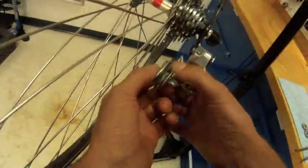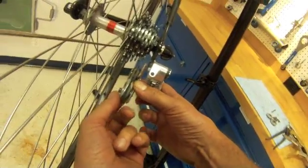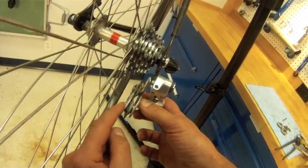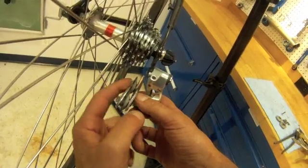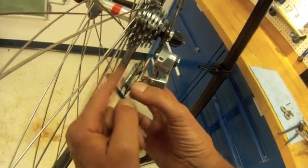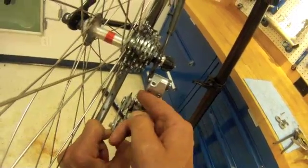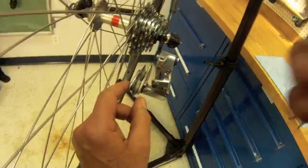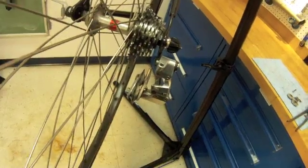So we're better. I think we're quite a bit better. The two pulleys are nice. This cage is tweaked in, deformed toward the pulley, or rather outward from the mid-plane of the bike toward the pulley. This one as well is deformed, but I think our two pulleys are looking pretty good. A little more fine-tuning is needed.